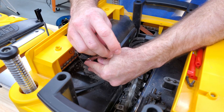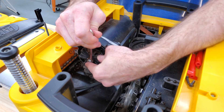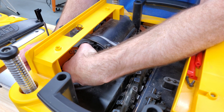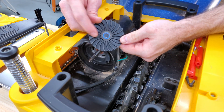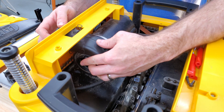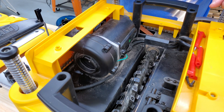The housing slides right out and there's your impeller. To remove it you need a half-inch wrench — yours might be pretty snug the first time. Once you get it loose, you can just spin the impeller by hand rather than rotating it with the wrench. After the lock nut comes off, there's a washer, and then the impeller slides right out. Notice that the side with fewer blades faces outward. Now put everything back in reverse order. The only caution: make sure you get all three clips, because if you forget the third one you'll hear a rattling sound — speaking from experience.